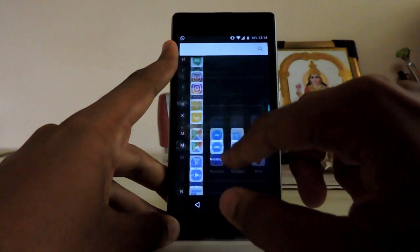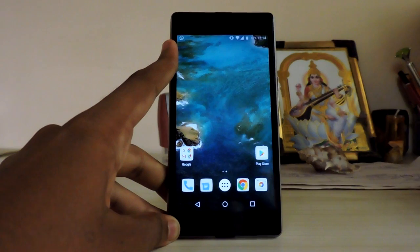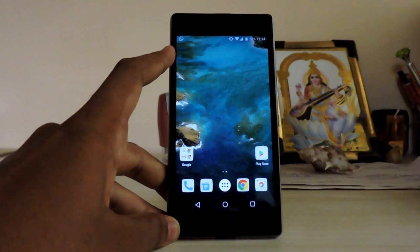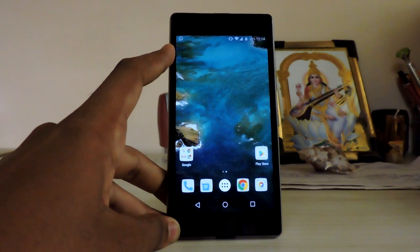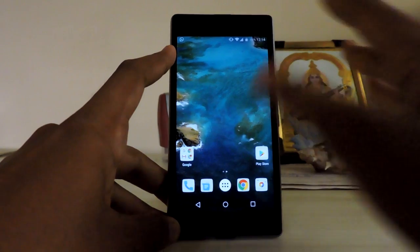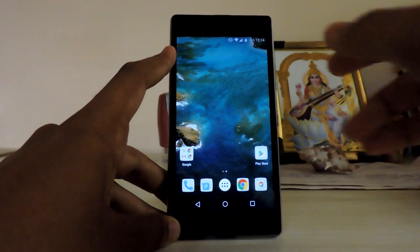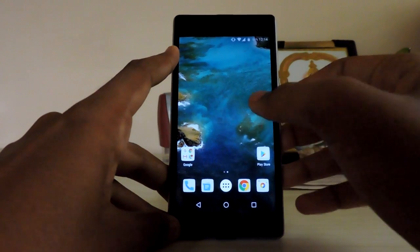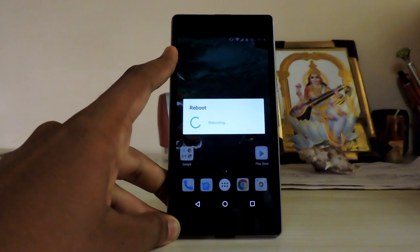This is for the Redmi 2 or Redmi Note 2, as you can see, but there is a different way to install MIUI 8, which is the MiFlash flasher — you just install that on the PC, connect your device, it downloads the ROM and installs it. But as many of you know, I live in a very underdeveloped city and don't have much internet bandwidth — it would take overnight. So there's another method: some guy made a backup and a flashable zip of MIUI 8, which is the traditional way.